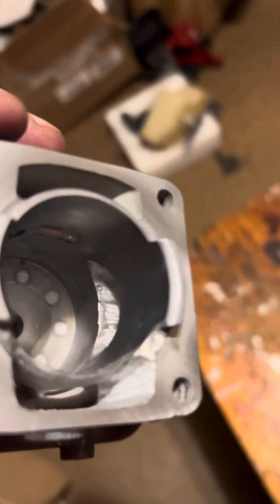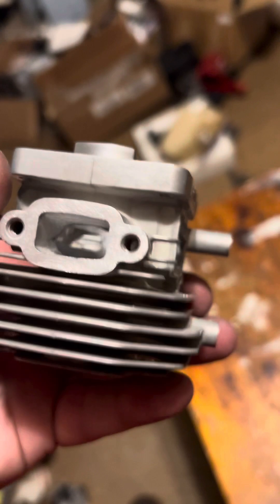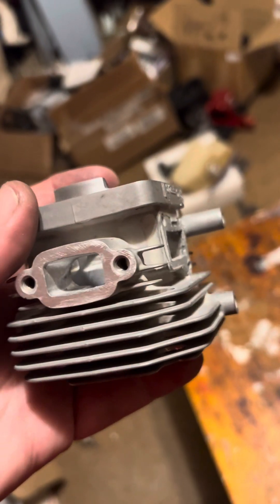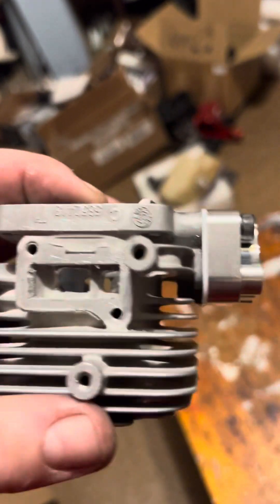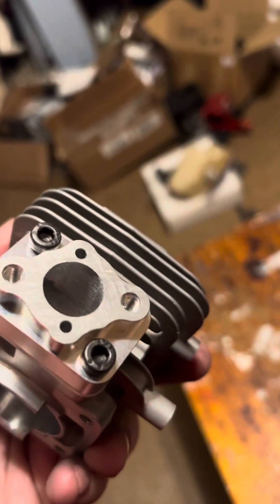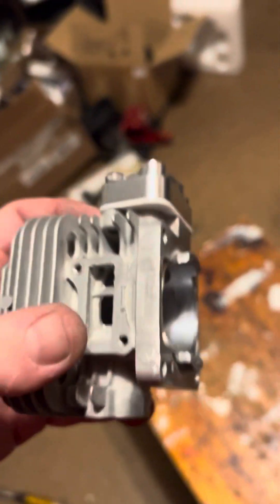Even though I have that program, it gets you in the ballpark, but there's still a lot of room for improvement. This cylinder right here has got our drag mod numbers in it — piston port. For some reason, I seem to be able to make a lot of power with piston ports. Other guys swear by case reeds, but I seem to really rock with these. My case reeds are kick-ass in my opinion, but I think these piston ports are outstanding as far as power is concerned.